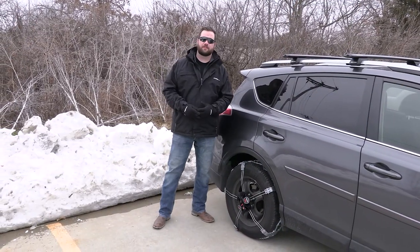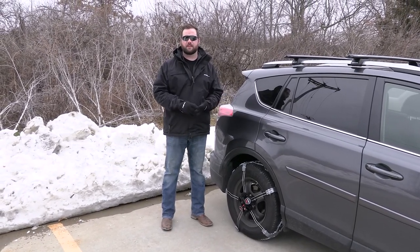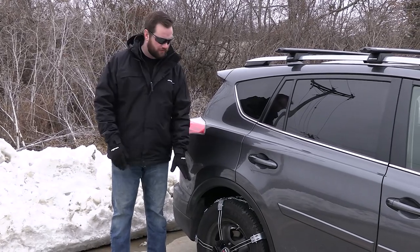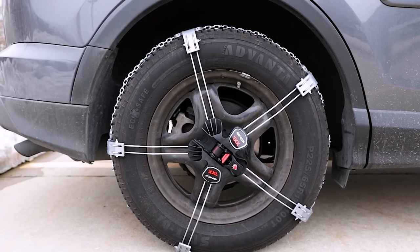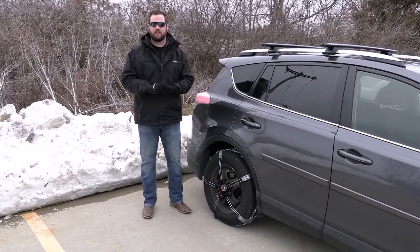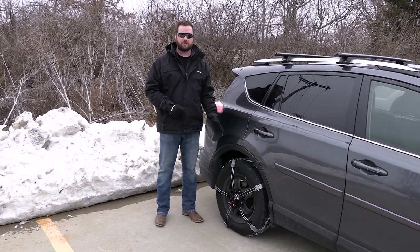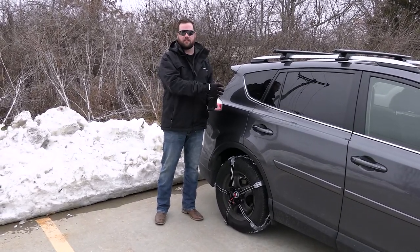When it comes to vehicle restrictions, there are a couple of things you're going to want to look into. The first and foremost is your owner's manual — it's going to tell you what tire chains, if any at all, your vehicle is approved for. Some vehicles are going to be so low clearance on the inside of the wheel well, whether it be the rear or the front, that you're going to want a set of tire chains like these, where they don't have anything on the inside of the tire. Another rating is a Class S rating, which you'll see in your owner's manual or online, and that is going to be limited clearance. You're going to have to get a tire chain rated for limited clearance so that you don't run into any brake lines or any other components on the inside.